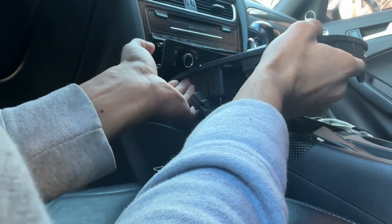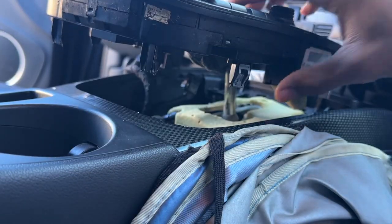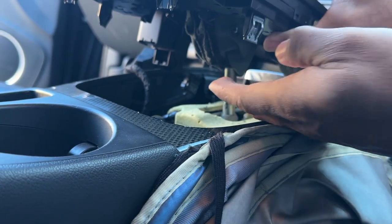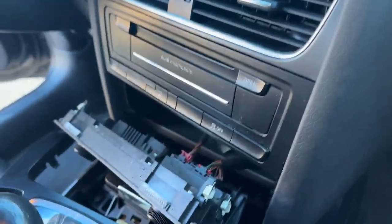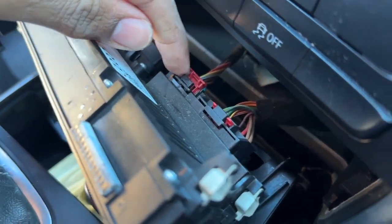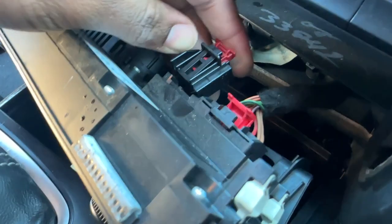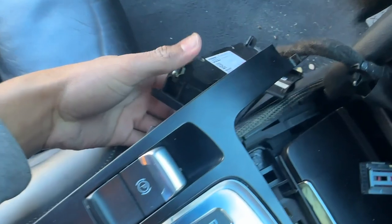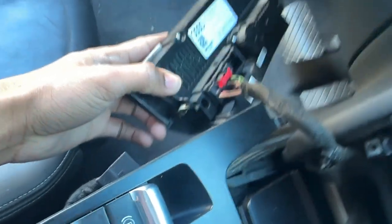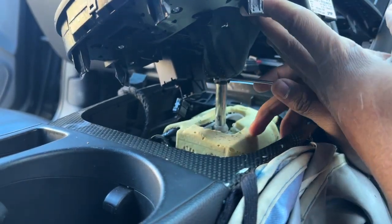Now all the wires are disconnected, this should be able to pull up a little bit more. Last thing to do is get the gear shifter leather off — there's going to be a little ring under the leather right here. I'm also going to remove the air conditioner, so pop it out, pull these little red tabs out — two separate wires, one there, the other one was kind of tight to get out, so I'm just going to hang it on the side.